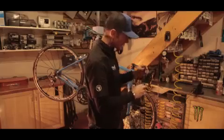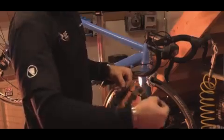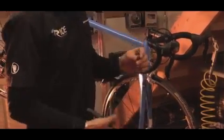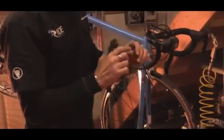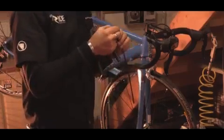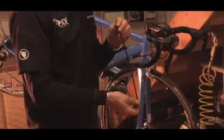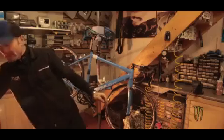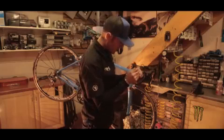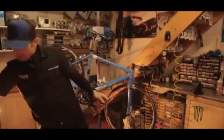Now it's worth noting this is a spiral cable on the outer. Derailleur cable runs straight along the length. The brake cable has more flexibility, it's a spiral wound cable. So when you cut the ends of these, if your cable cutters aren't very sharp, you can sometimes burr the ends over. You need to check that before you try and thread the inner cable through. It'll make life easier for you and you get a much better end result. So this one's cut nice and cleanly. We'll just open up the end of the plastic sheath that's inside. Make sure we've got no burrs. Everything's nice and clean. So that's your outer ready to go.